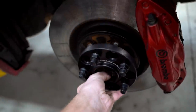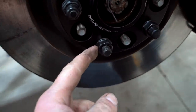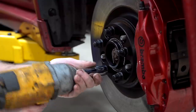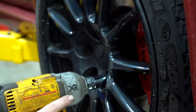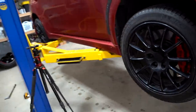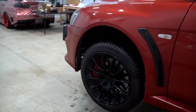Spacers are very very easy to install guys. All you gotta do is pop off the factory wheel, this guy's gonna slide on there just like that and she fits beautifully. The black nut side goes on the wheel spacer studs — we're gonna put those on the factory wheel studs, and then the wheel is gonna bolt onto the new studs. We got the wheel spacers on the passenger side and we're gonna get this thing down on the ground.